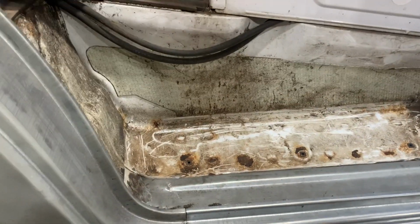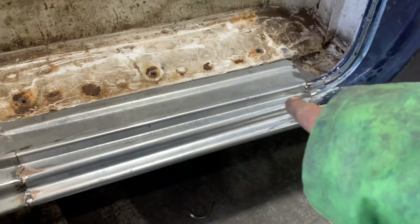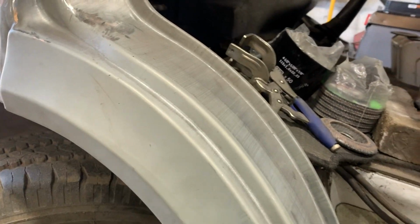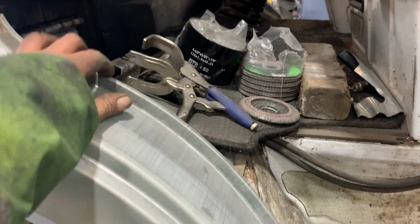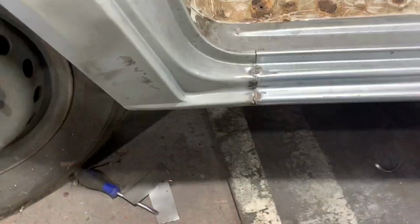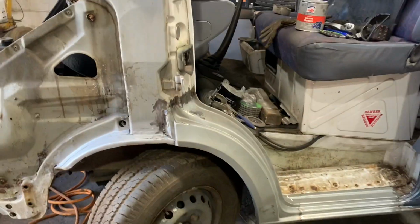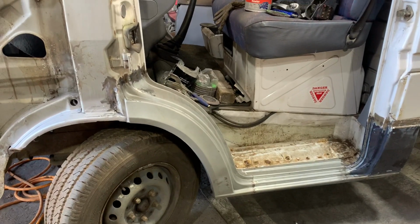But so all we are now is we can go back on all these clean on the inside. We can go load of spot welds across here, up here. Spot weld this inner arch all back together once we've pulled it in. What I will probably do is spot weld all of this first, and I am going to have to slightly stretch the lower panels to get everything to meet up, but that's not a particularly great worry. Anyway, I think we will spot weld over here.